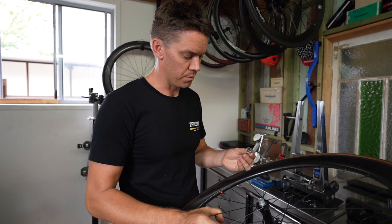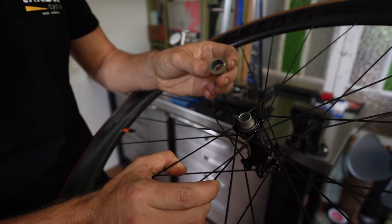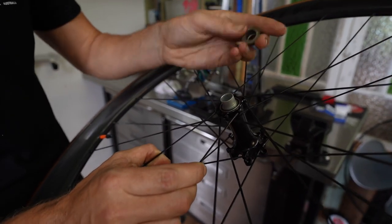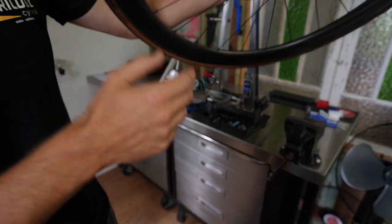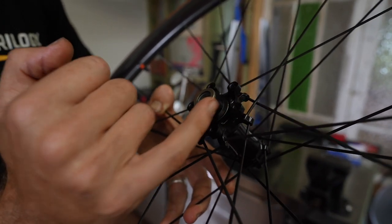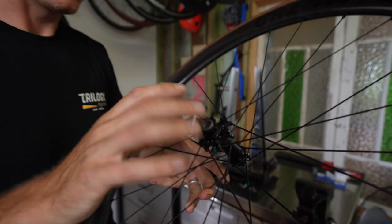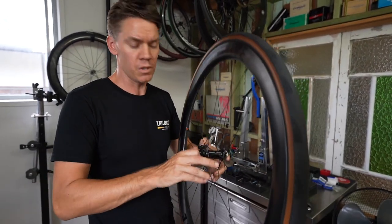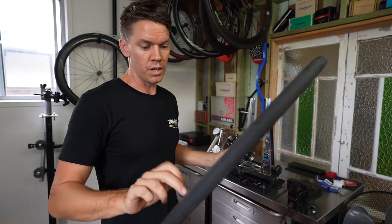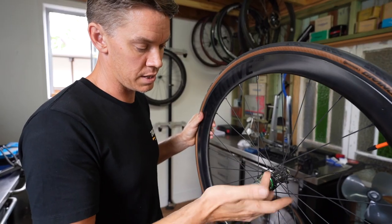Given these results, I doubt the creatives are going to be spending much time off my bike. A major factor in that speed is coming from the hubs, which Aaron's going to deep-dive into now. It's a pretty simple system. They are so smooth and perfect, I kind of want to leave them alone. The dust cap — I have not touched these from the factory. From the factory they are greased. There's a sleeve that runs through the bearing, and on the other side you see this beautiful CNC. There's a micro adjuster here — that tiny adjuster preloads the hub bearing and it is very, very sensitive, requiring really refined movements.